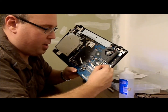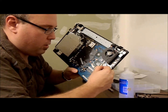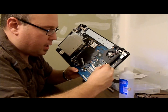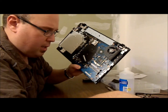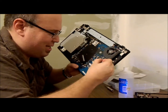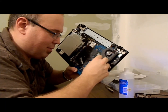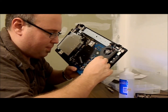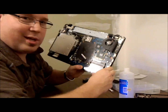I'm just going to scrape that off a bit here. I want to make sure that you've got a nice clean contact for the new thermal paste that I'm going to put on there. Just using a Q-tip and scraping off — I haven't added any isopropyl alcohol on this one yet. Don't hesitate to use tons of Q-tips, really. You want to make sure you get a nice clean surface, and if your Q-tip stops cleaning, just chuck it and get another one. Look at that nice finish — you can probably see my camera in there.